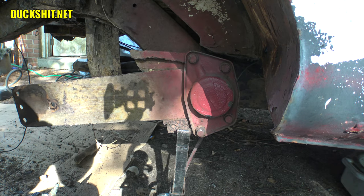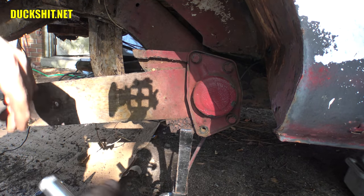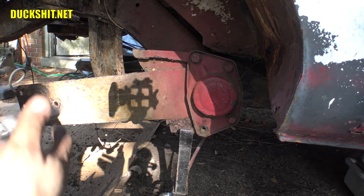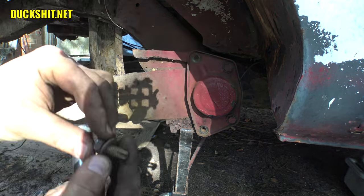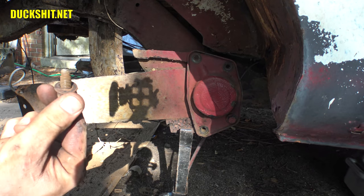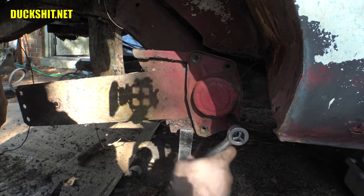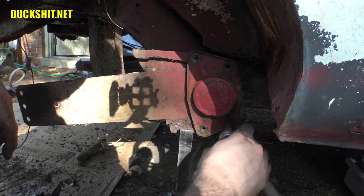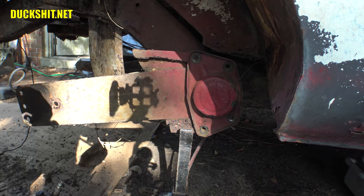Okay. Yeah, it's got the wrong kind of washers under there, and too many. And again, self-tapping and the wrong thread. So this has definitely been monkeyed with. Three for three, self-tappers. And the last one, this one, the 15 millimeter tool actually fits on a whole lot better. Nope, also a self-tapper. Yep, not right to be on here.